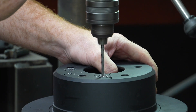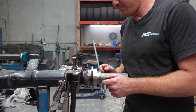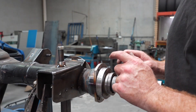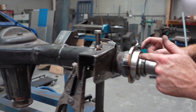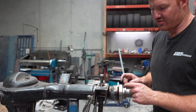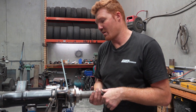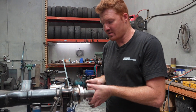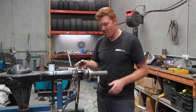So what do you mean when you say mandrels? These are machined — we call them a mandrel. They've got different sizes. They've got a shoulder for the bearing end to sit onto. And they are to suit — they're like 0.1 of a millimeter smaller than what they need to be. So when we weld everything on, it basically is just a steady for when we weld it on and to align our bearing.